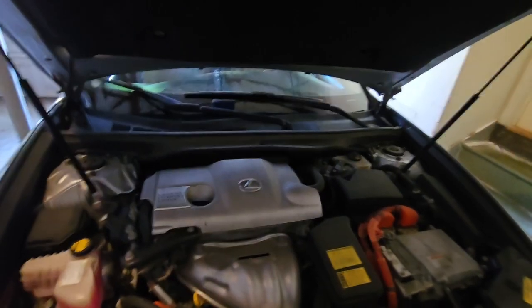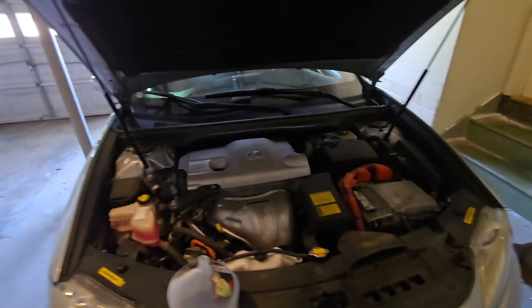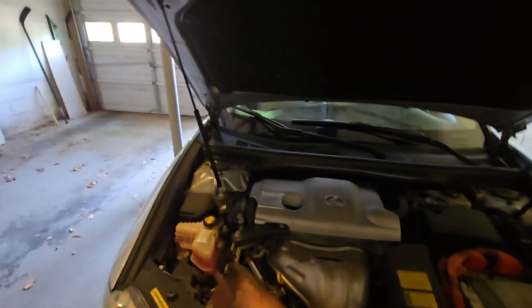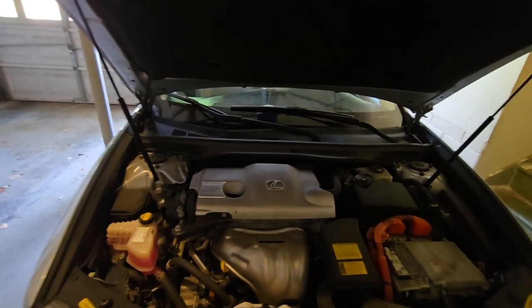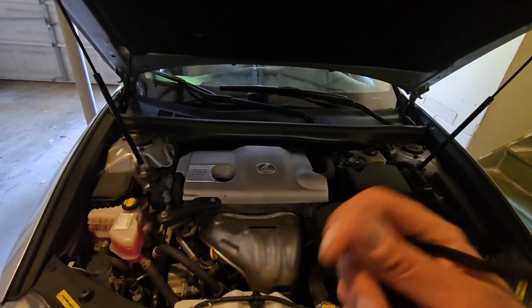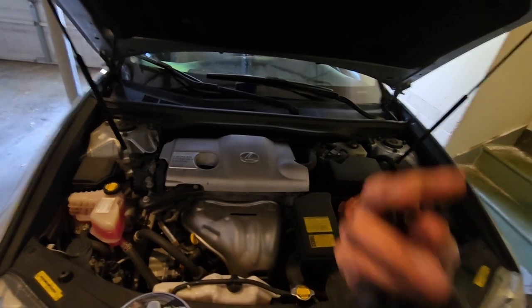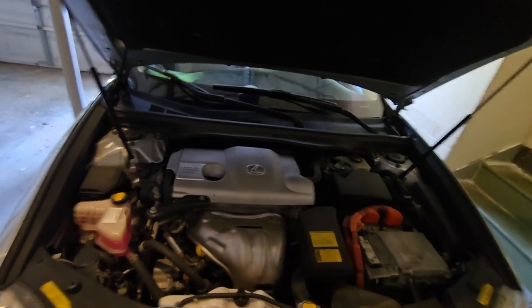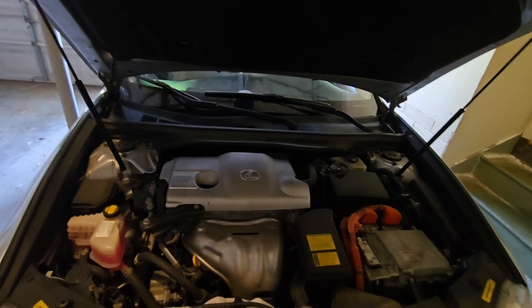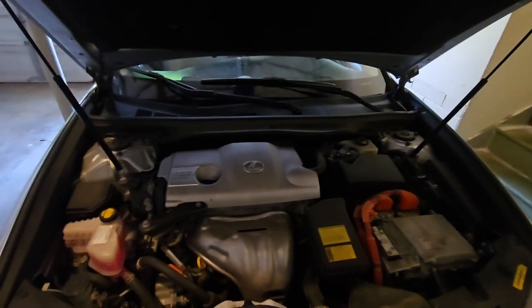I can say this, if I had to do it again, I would not take off the splash guard. Splash guard was easy coming off, a nightmare going back on. You can reach the inverter drain plug, no problem. You don't have to take the splash guard off. The radiator stopcock was easy enough to turn by hand if you can get your hand around the splash guard. I would be willing to make a mess, than to take that splash guard off again.